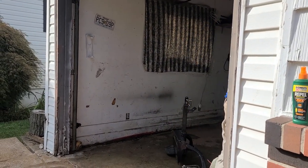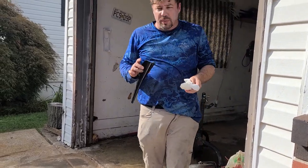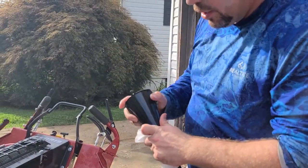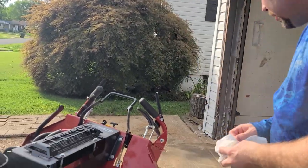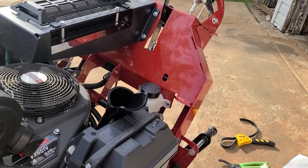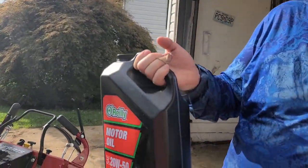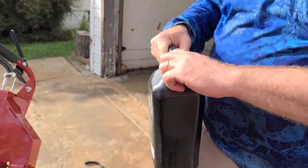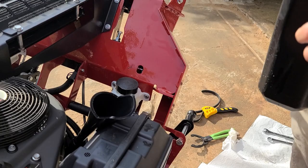You can't really even worry about what they're doing, because there's so many levels of it that your brain will just explode. Okay, so what did I say I'm doing? 20W50? Yeah. Five quarts. So we're going to take it to the 4 and to the 3. It'll be just about right. It says 2.1, so you hit it and go a little over.